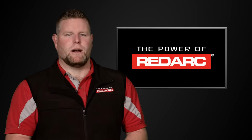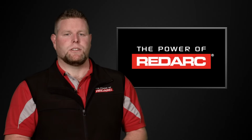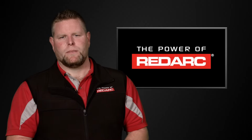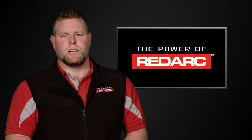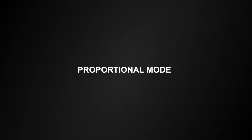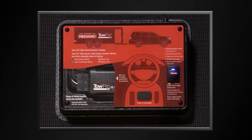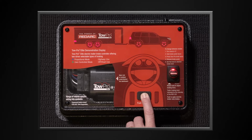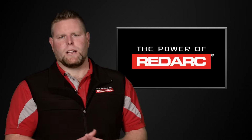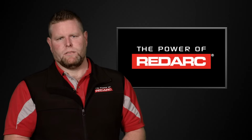This display is a great way to demonstrate the operation and two different Tow-Pro Elite braking modes. Let's have a close look at these modes and how they operate. Now, the most commonly used mode for general highway towing is the proportional mode. This mode is indicated by the remote head LED glowing blue. But when the vehicle is braking, the LED will change to red with the intensity indicating the level of braking being applied.